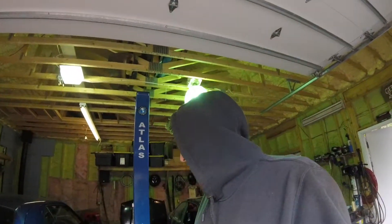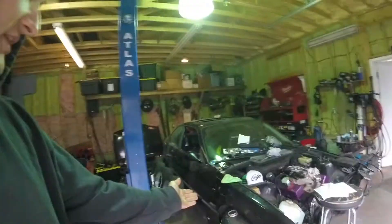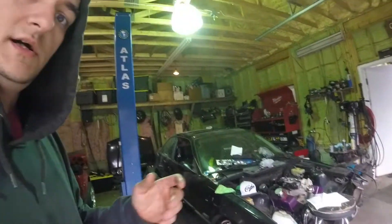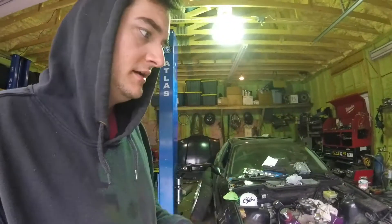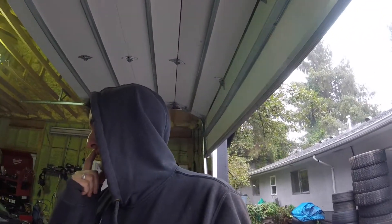Today we're taking the knuckles and LCAs out of this car. I'm going to get the old knuckles that were originally done for this car, because Sid wants to put the eFactory kit on his car — which is what I now have in here. To do that, you need the factory knuckles to bolt all that stuff in there and have sweet angle.